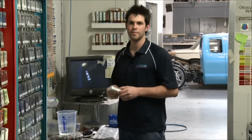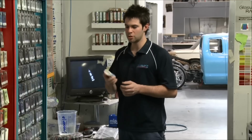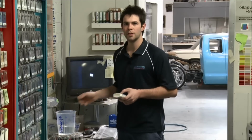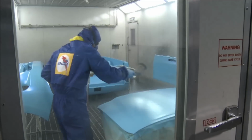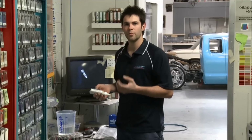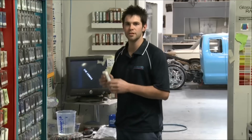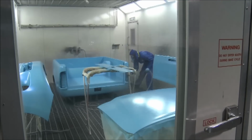All right, we've put the base coat on now and we're making up the pearl. Being a three-layer pearl, you actually put this pearl here, it's called sapphire blue. It's a very strong pearl. You mix it with a clear base coat, and that becomes a binder to put it on evenly. The good thing about three-layer pearls is you don't actually put it into the colour. It doesn't change the colour. It makes you look through the pearl to see the actual blue. And wherever you look at it in the light, you actually see the pearl. And as you move around the car, the pearl follows you as long as you've got daylight on a spot. So when you're looking at it from the side, you don't see the pearl, but when you look at it head on with some light, you get to see the pearl. That's a great thing about this stuff. So we'll make it up and then we can get on with the job and put some clear coat on.